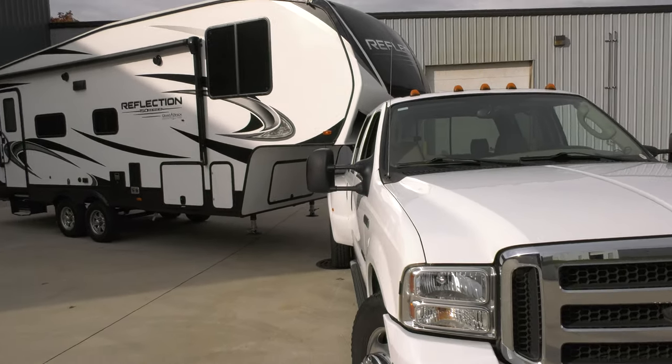Or if the front of your trailer is squared up, that's going to also work against you. So those are things you need to think about before using a product like the Andersen Ultimate or the PullRite SuperLite, which I'll get to in just a moment. But when we really look at that short bed truck and knowing that you want to be able to turn and not hit the cab, the SuperGlide, in my opinion, is a better product for that short bed application.